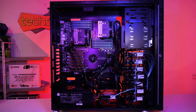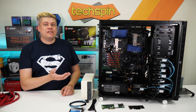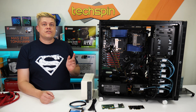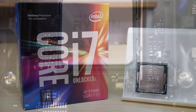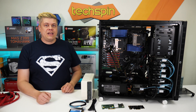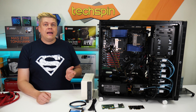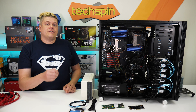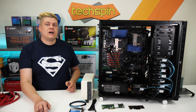We got this whole unit for $130, but we screwed up. This board is an EVGA Classified SR2 from 2010 and is probably the worst pick for a server build — but a great demonstration of what not to do. You're looking for a motherboard with three PCIe x16 slots and onboard graphics using a low wattage CPU, which is what makes this SR2 and dual CPU combo a horrible purchase. Intel CPUs often have integrated graphics on chip enabling motherboard video out, but mainstream AMD CPUs often don't, meaning no video out from your motherboard even if it has a VGA or HDMI port.